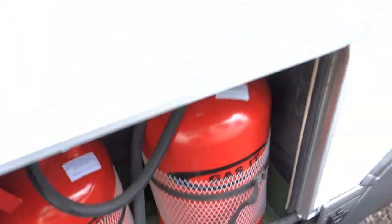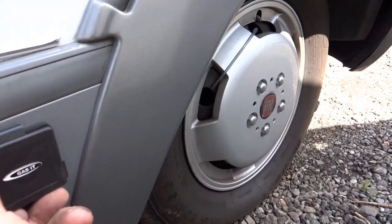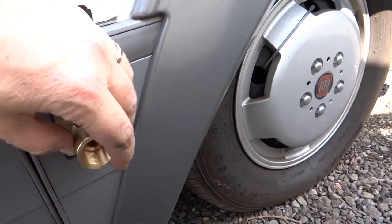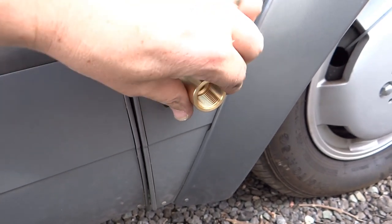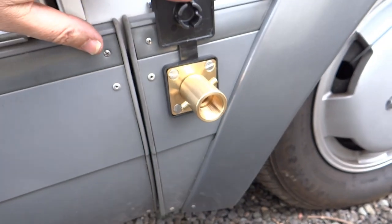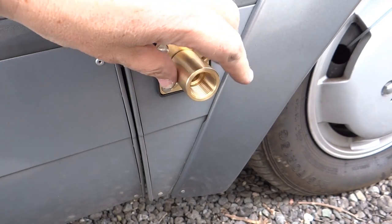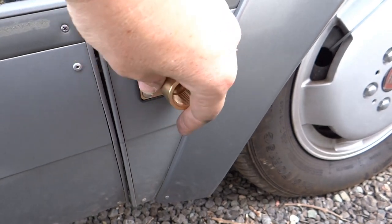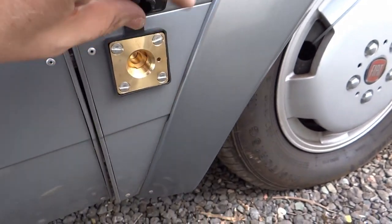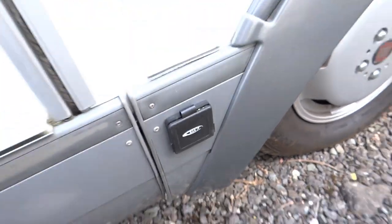When we come to fill up, we won't actually need to open the locker door. You just pop the dust cap open, screw your connector in — whichever one you need for whichever country you're in, so that's the British one going in — give it a little tighten, pop the gun on, and fill it up. When you're done, take the gun off — there's a burst of gas and this gets really cold, not so cold it'll hurt you but not that pleasant. Then unscrew the connector, pop the dust cap back on, and shut it. Job done.